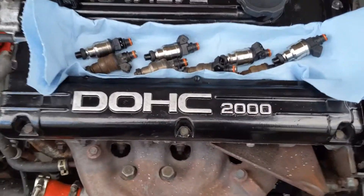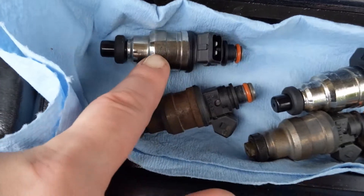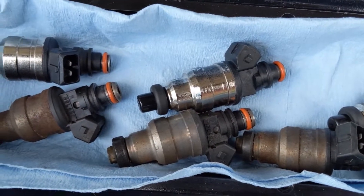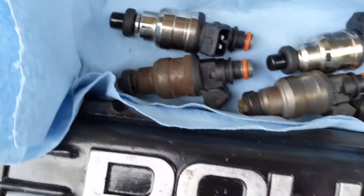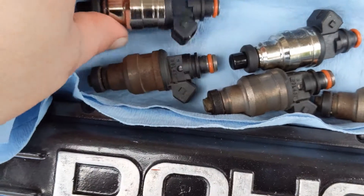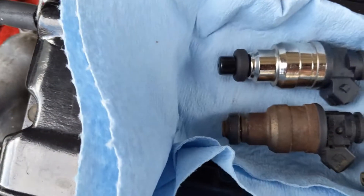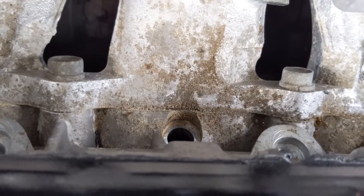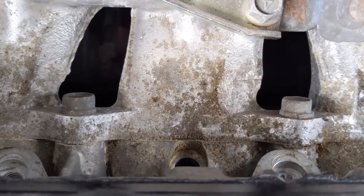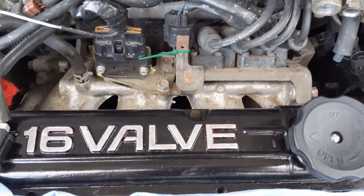Here's a quick comparison: these are the old rusty ones, these are the new shiny ones. They are secondhand so there's a little surface rust and some markings, but they all work. I replaced the upper seal O-ring and the seats on these injectors. They're basically identical down to the plug and body style — the only difference is they're just a little bit longer, and I don't think that's going to be an issue. I've got a trick I learned from Jaffro Mobile: to keep your spacers in place while installing injectors, use RTV black. I'll clean up the seats and then we'll start putting everything back together.